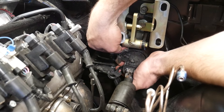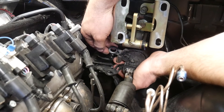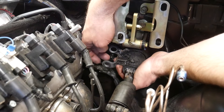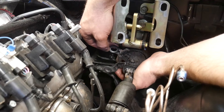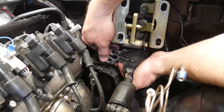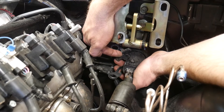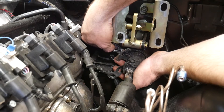This center piece is what moves with the shifter. There's a little piece of metal that sticks out from each selector. When it slides back it engages one, slides the other way and engages the other one. I had considered bolting them all together to make a solid unit, but I think what I'm going to do is weld this locating tab inside of this slot so that it can't move and come out of there.